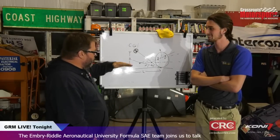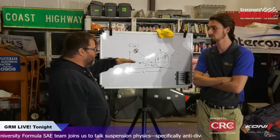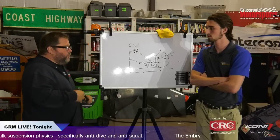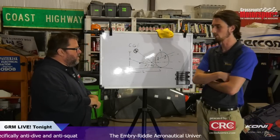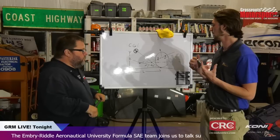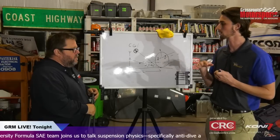So we're basically looking at raising and lowering front and rear mounts, and like we mentioned before, as you change that stuff, especially in the front, it could start doing weird stuff as it articulates, to your toe links especially, I would think. That's the other thing. If we're going to change antis, then we also have a provision in there to change the angle of the toe link. As your antis change, at the hub or at the rack? At the wheels, the upright.